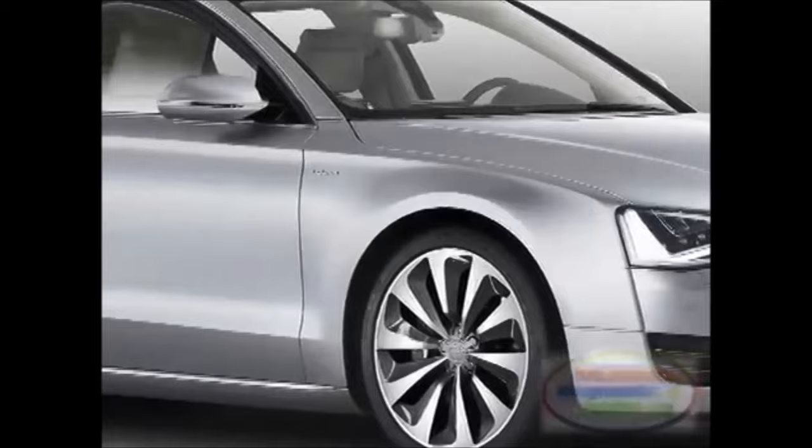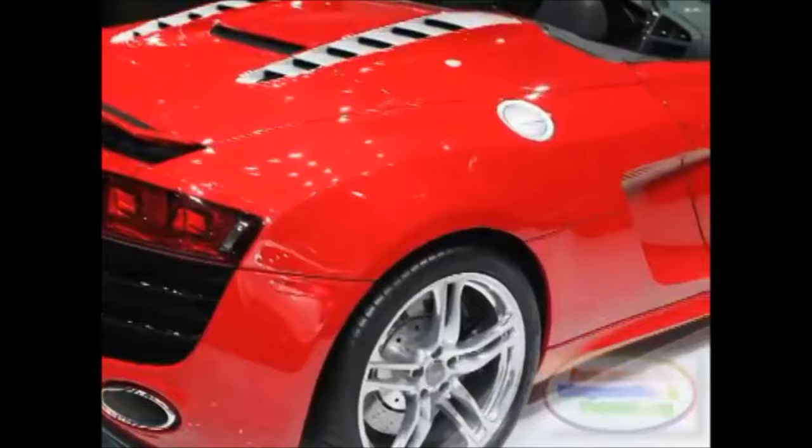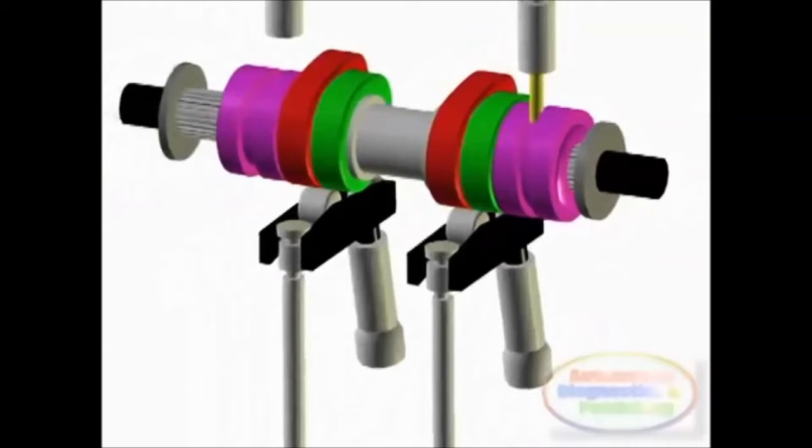Audi Valve Lift System Valve Timing. Audi Valve Lift System was introduced in the 2.8-liter, direct injection, V6 and will be expanded for use in other members of the V6 and V8 family. The Audi Valve Lift System is a cam lobe swapping type.